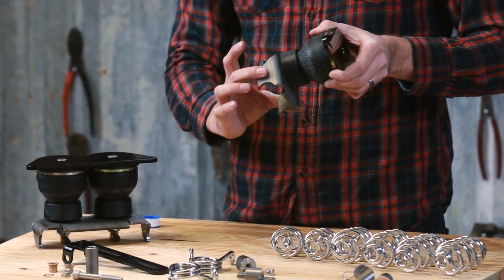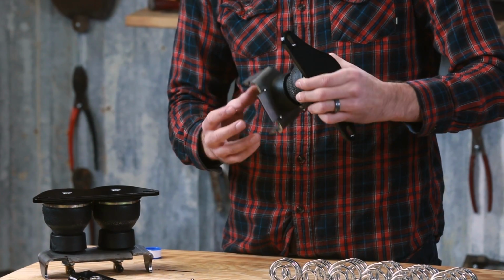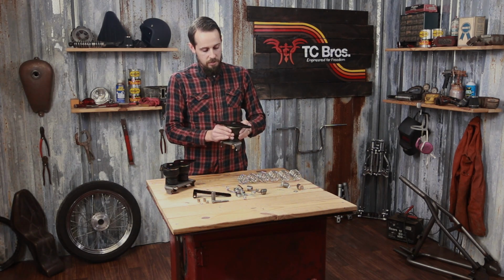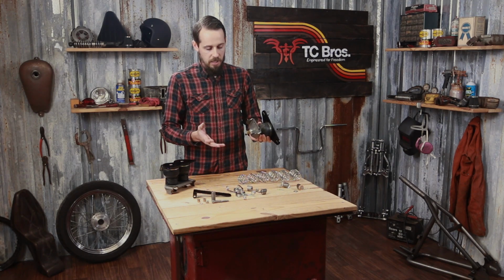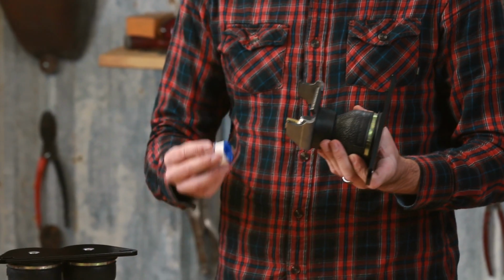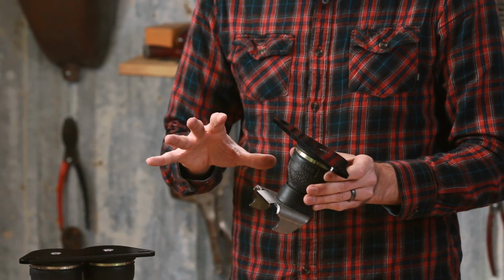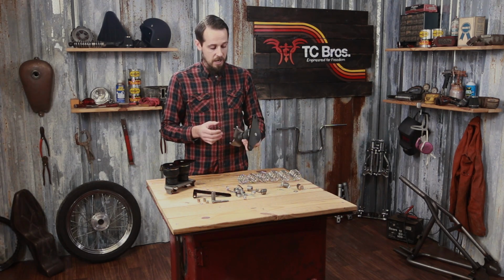They include a weld-on mount that's already coped for your frame tube as well, much like the seat mounting bungs are. Fits 1-inch to 1.25-inch frame tubes easily. And what's nice about this kit is there's very few components to really hide. There's no compressor needed. They've got a simple bicycle-style Schrader valve. As long as you use the supplied Teflon tape on all your fittings and tighten everything securely, you should only have to fill your bag once and get it adjusted to the PSI that works best for your rider weight and never have to worry about it again.